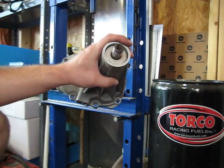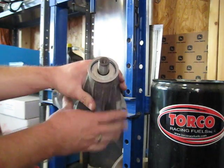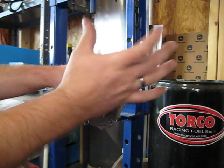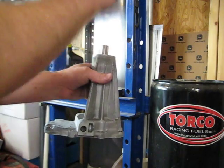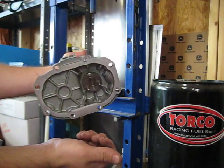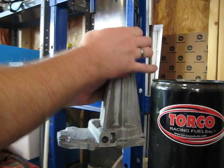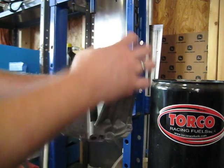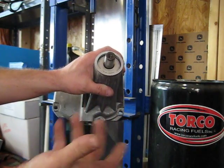We should start off with removing your supercharger pulley with whatever you have. There are a couple different things you can do. If you're going to rebuild the snout anyway with new bearings and new seals and you don't care about the pulley, you can use your arbor press pressing on the shaft where the shaft will come out the bottom unrestricted, not hitting your plates or anything like that. You can run it all the way down — the pulley will stop on the bearing and the shaft will press right on through and then everything will just kind of come apart. Or you can pull it off with a puller, whatever you choose to do.